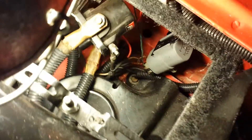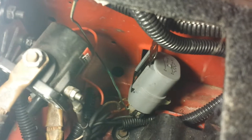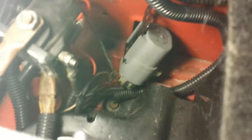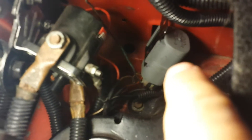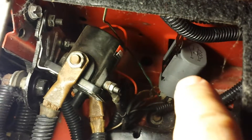The last thing I did was I used the factory wiring for my fans, but reconfigured them a little bit. The factory fans — there are two of them back here behind the radiator. My objective was I wanted these two fans to run constantly, but I didn't want to alter the factory wiring too much. You'll see there's a gray relay right there, and there's another relay just like it right below it. The two relays control the fans — these two fans that are behind the radiator, you can kind of see them right in there.